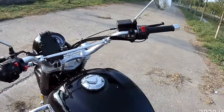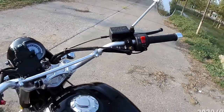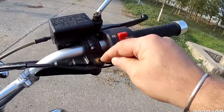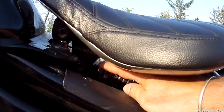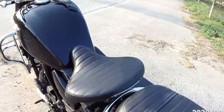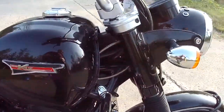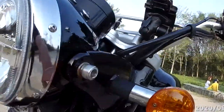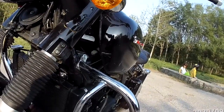The finish of the bike is really good — the paint on the tank and sides. But all the little things show that it's still a Chinese bike. Although this bike's only three months old, there's rust on this nut here. When you look underneath, these little bolts are starting to rust. There's just little bits of rust coming along this seam here. On the front forks, there's rust starting to weep down from these headlight mounts, and rust around this bolt here. You just don't get that on a brand new Japanese bike.